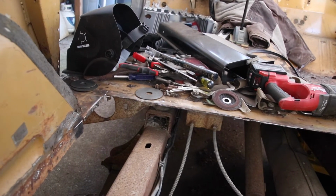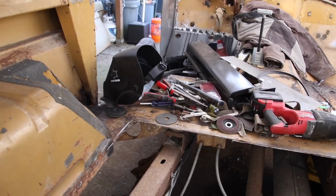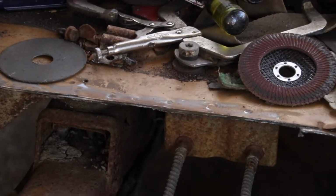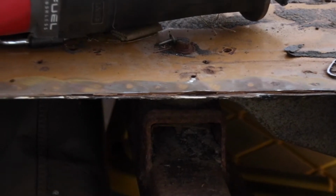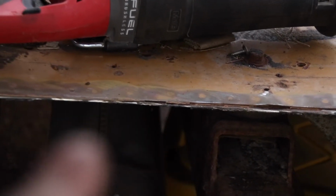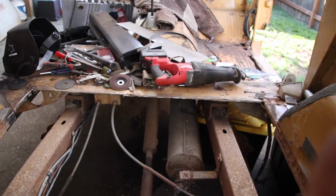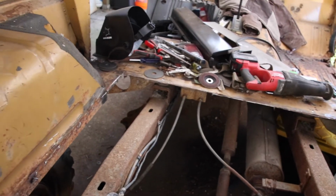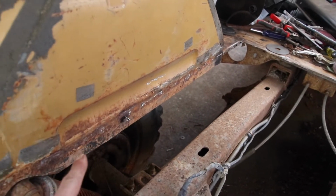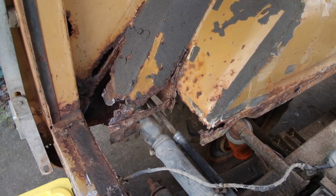I don't have my drill with me, it's on a job site, so that front, all those spot welds right along that edge there, I gotta drill out to get the under layer because the bed clearly goes down and underneath of that lip there, so it tucks under like that and then it gets spot welded from the top. But I got all the sides of it, a little cleanup to do here, and then some major repair work to do there, but I have all the pieces for it.